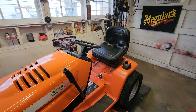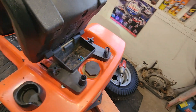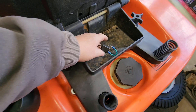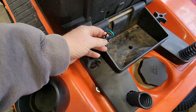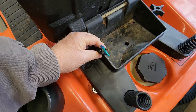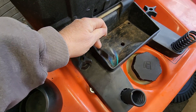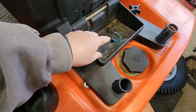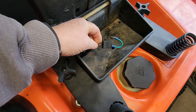The seat switch is the typical culprit, and I once had a jumper on it. Then with some suggestions from folks, and after testing the switch that was in here when I got it — which was collapsed and taped up — I realized that in the seated position this should be open. Right now it is open. However, I have tested it a million times with the jumper in or the jumper out. It is only a two-wire switch.